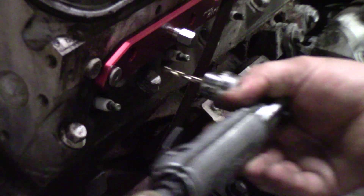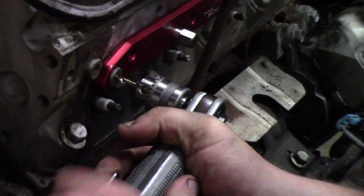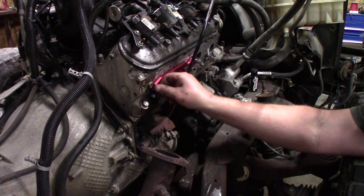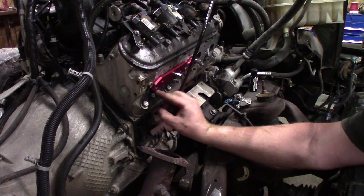With the bigger bushing, it's the correct size for the drill bit for the extractor-style removal. With the larger bit, same thing — put a drop of machining oil on there. The goal here is two things: relieve some of the pressure and get deep enough to put in the extractor, which only goes in about a quarter inch, so we don't need to drill super deep. Once we have the next hole size drilled, we take that bushing out and take the block off to get to the remainder of the stud.